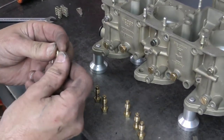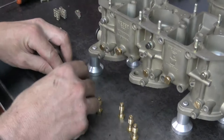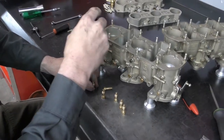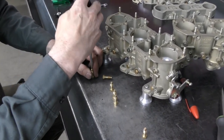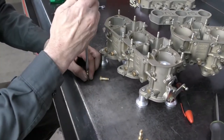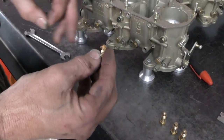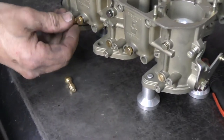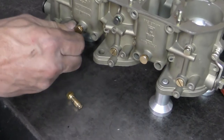I'm just going to get these started, screw them in, and then to tighten them — if you leave them sitting on your bench, use a 10mm open wrench or box end and just nip these down until they seat. We're not looking to hold the entire engine together with the main jet. I'm going to take my copper gasket and drop it on — it should locate and seat all the way down around that banjo fitting right there. Then with the gasket in, just going to screw that in, and these should screw in finger tight. Then we'll come back and tighten each one.